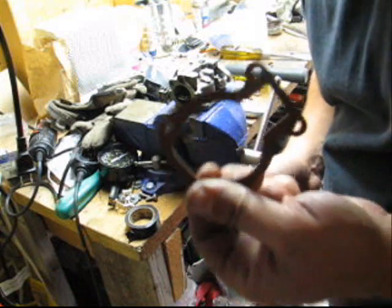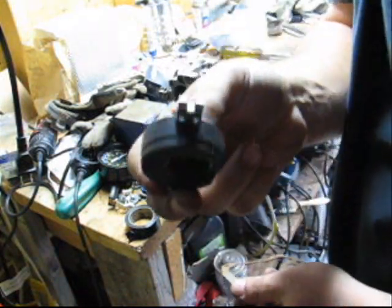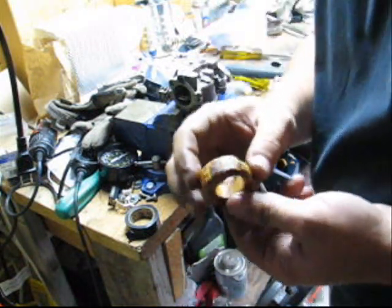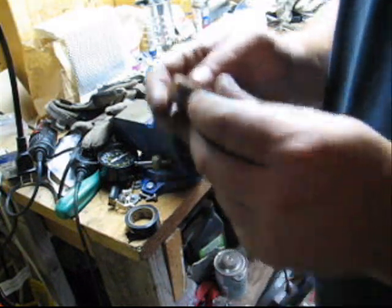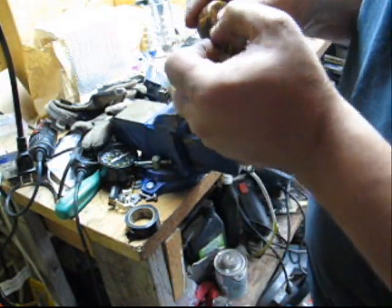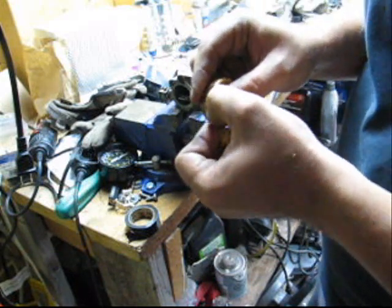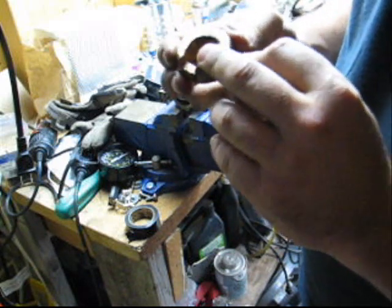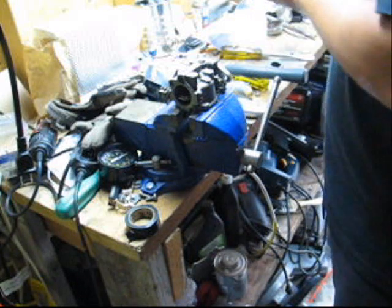Comes with a gasket for your fuel bowl, and they come with a float, which is one of the most important things. These old cork floats, the ethanol gas of today wears off, I guess it's a varnish or a shellac. It wears these floats off. You can see there that this one's already started to break apart. I can just sit here with my thumbnail and scrape it off. So that float's probably saturated and starting to break down. So it's a good idea that we replace that.